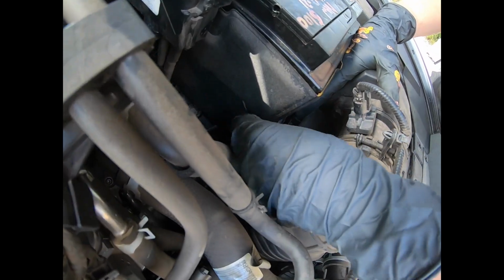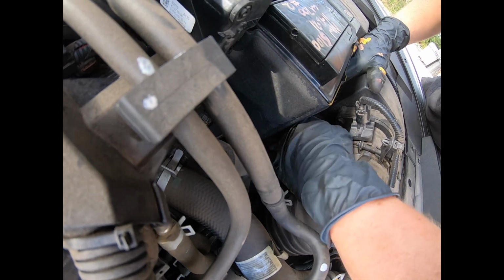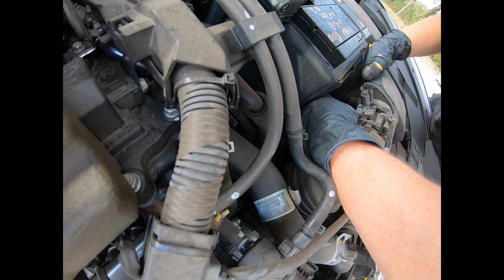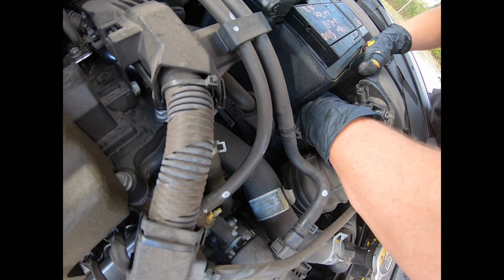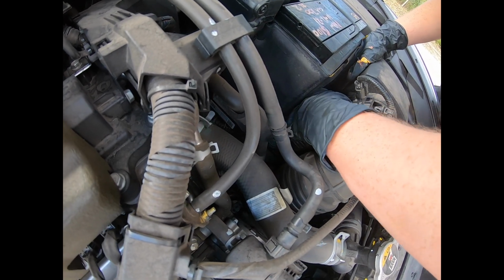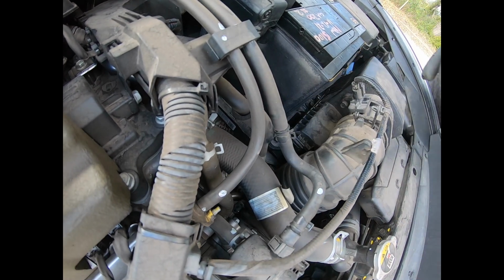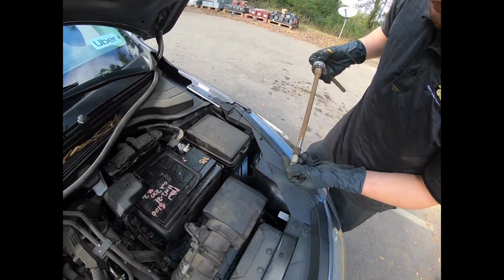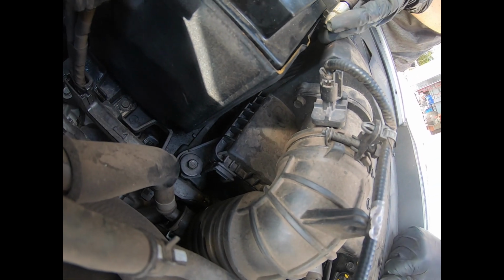What we're doing now is we try to stick the bracket back into that battery. It's very hard too. You've got to make sure you take your time. Take it very slow and put that bracket down first. Get it flush down. Once you get the bracket flush down flat in the center of that battery, then you can grab your bolt with your long extension and tighten that bolt up. But as you can see right now, Matt is having a difficult time trying to get that squeezed in there. Here we go with the extension.